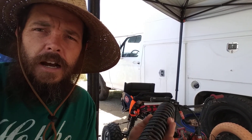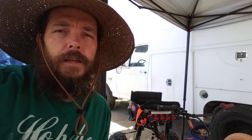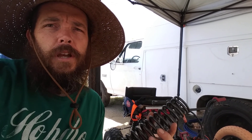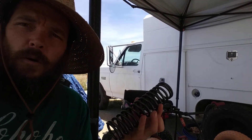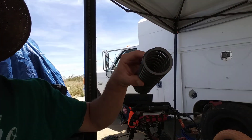With 3000 watts and a single shock setup, what I did order are these coils right here — these are machined coils which I ordered off McMaster-Carr. If you haven't ordered from them before, or you've had industrial or engineering projects where you needed a specific bolt, screw, or part, McMaster-Carr is the place to go. Fox Racing's smallest and lightest coil is rated at 150 pounds — even two of those totals 300 pounds, and I'm not at 300 pounds. So I ordered two identical eight-inch flat-ground coils from McMaster-Carr. They're a bit oily and greasy because they're machined and haven't been powder coated.